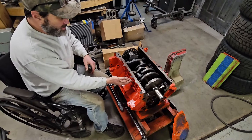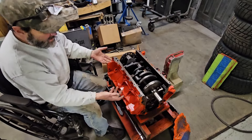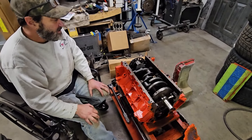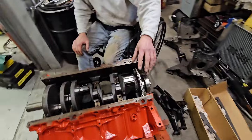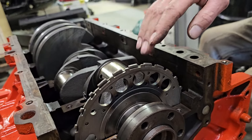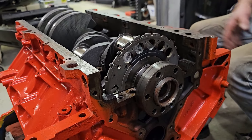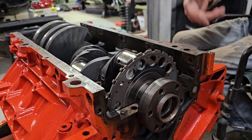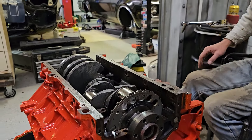Another one, like we talked about before — this motor's upside down so it's really easy to see — there are no knock sensors right here, and the knock sensors are in the top of the valley pan on it. So this is a Gen 3 motor, and that's what tells you the difference. Now the motor's apart. This is a 24x reluctor wheel right here. You can see it's a double width with small teeth and big teeth. This is what your crank position sensor reads — flywheel speed and orientation — and it sends that signal back to the ECU telling it where it's at in relationship to the cam sensor. It compares the two and adjusts your timing accordingly.